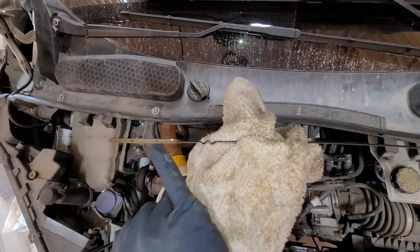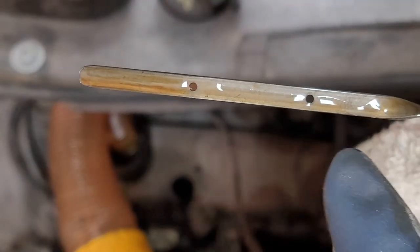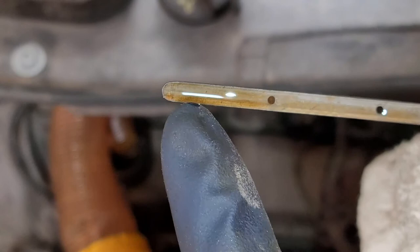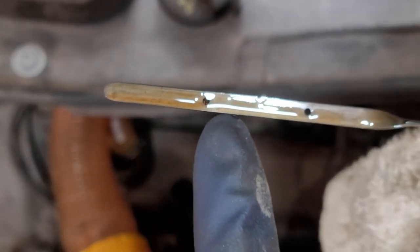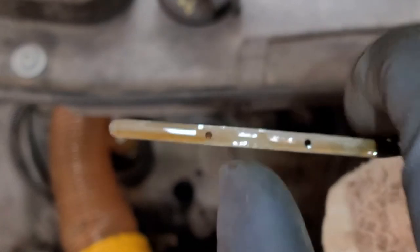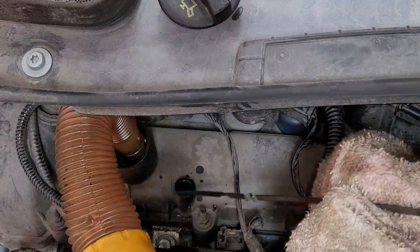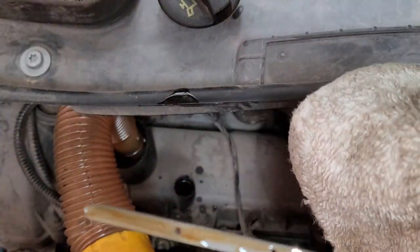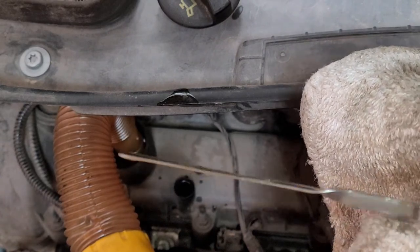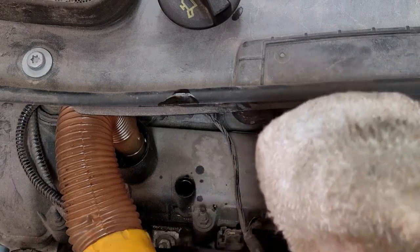You can see oil right there on the dipstick. You see how there's oil all the way up here — make sure you check both sides of the dipstick, since one side will be higher than the other. Go by the side that's at its lowest because as you're pulling it up, sometimes it scrapes against the block. Our fill mark is right exactly here. We just need to add one quart, so we're going to add one quart.